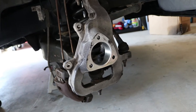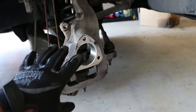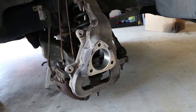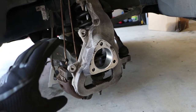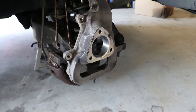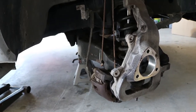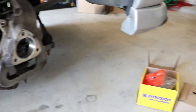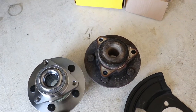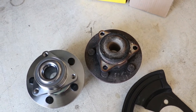I cleaned up this spindle nice and clean — it had a lot of dirt kicked up on the inside where the new wheel bearing is going to go, and I just didn't want the dirt to prevent the new wheel bearing from seating right. A pro tip: get yourself one of these three or four dollar bungee cords from Walmart so you can suspend your brake caliper and it doesn't put all that tension on the brake line. Over here I've got the new wheel bearing and the old one — the old one looks pretty beat up and pretty shot.